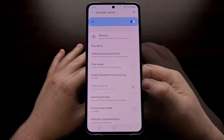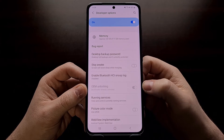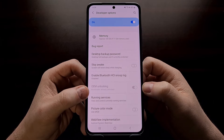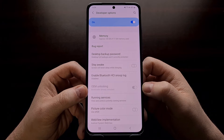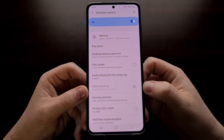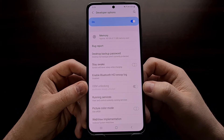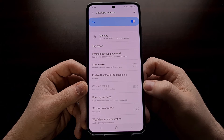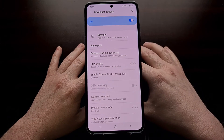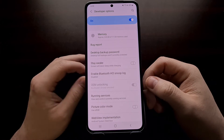I just wanted to point out that even if you go into the developer options menu and see that this toggle is grayed out with text saying the bootloader is already unlocked, that doesn't mean you can't relock the bootloader. We just need to lock the bootloader first before we disable this toggle and prevent it from being unlocked in the future.